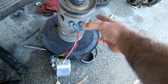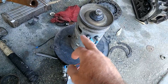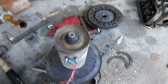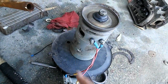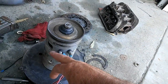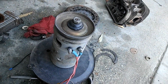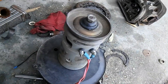With your positive and negative connections still there, go ahead and ground the field wire — and hang on to the generator, because that six-volt generator connected to a 12-volt battery is going to spin really fast. It'll spin backwards. If it does that, the generator is good.